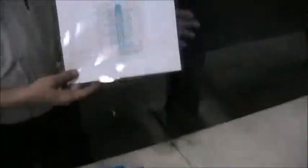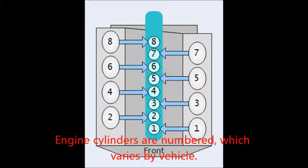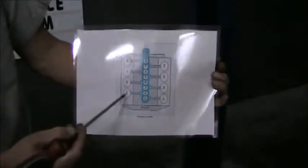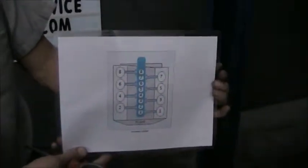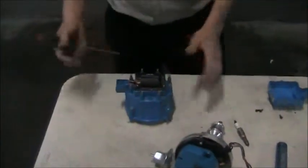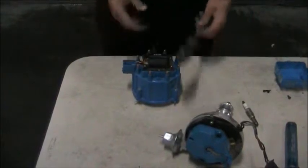This is a demonstration of how the cylinders are numbered on this particular vehicle. On this engine it's one, three, five, and seven on one side, and two, four, six, and eight on the other. This varies on all engines and you need to look up your firing order to know how to correctly wire it. Now we'll start with the ignition coil. The ignition coil is the voltage source for the electronic ignition system.